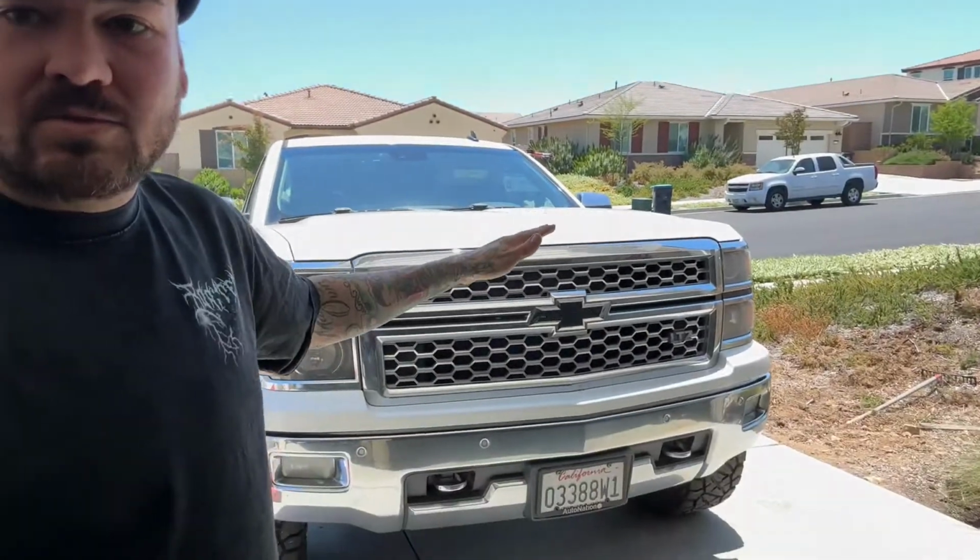So I'm assuming you're here because you want better braking for your Silverado. One thing about these year Silverados is because they go into the 4-cylinder mode, they actually have a vacuum pump to back up the brake booster and provide vacuum to it. In most vehicles in any other year Silverado, they've done it to where it goes to the intake manifold. So what we're going to be doing is deleting the vacuum pump, and there's a few products you have an option to use to do that.